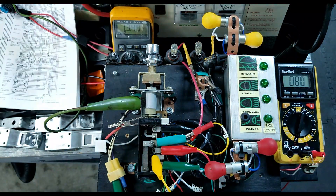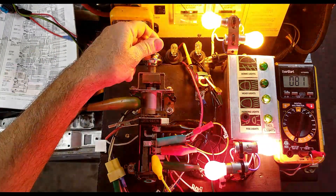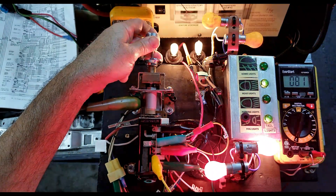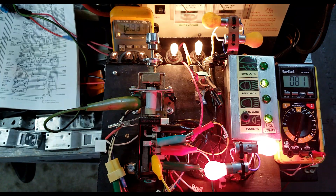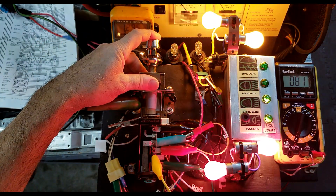Test number two: tail and headlight operation. First position from parking — tail lights on. Second position — front parking position, front parking lights are on. Back to first position and off.